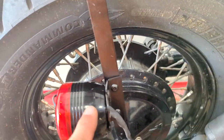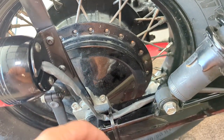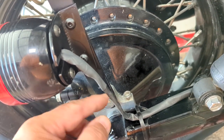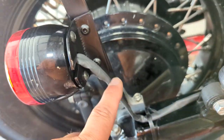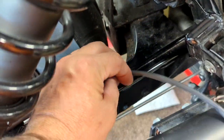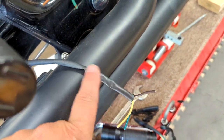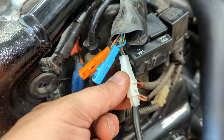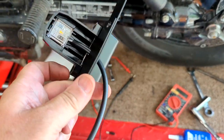Back at it — went ahead and got the taillight assembly on and rewired it from the inside out using heat shrink, though not actually activating it yet. We may do some additional sealing in this area because we used a smaller heat shrink going into the larger heat shrink to keep water out. The plan is to run it down the swing arm, put another zip tie right here, and we've got this excess coming from the taillight assembly up to the plug-in on this side.